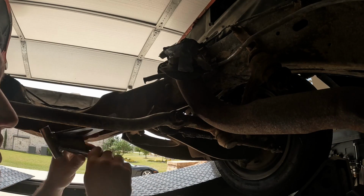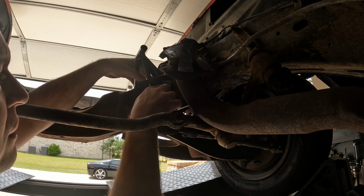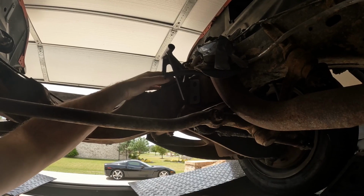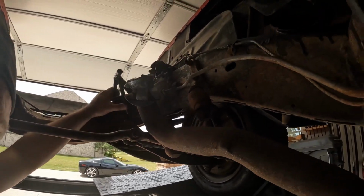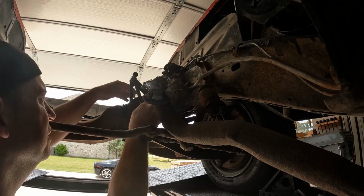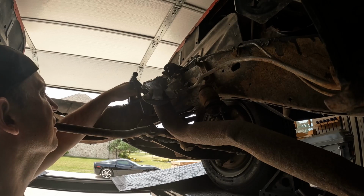All right, it's passenger side. They're saying it goes in something like so. Doesn't look too bad. The old fuel line's kind of in the way. Cut that out in a minute. But I think the idea here is it's a little cramped under here. So the idea is these two rivets come out. They give you two bolts to go back in place of the rivets, and then two bolts come in up top here, I believe, and bolt the top part to the cross member.